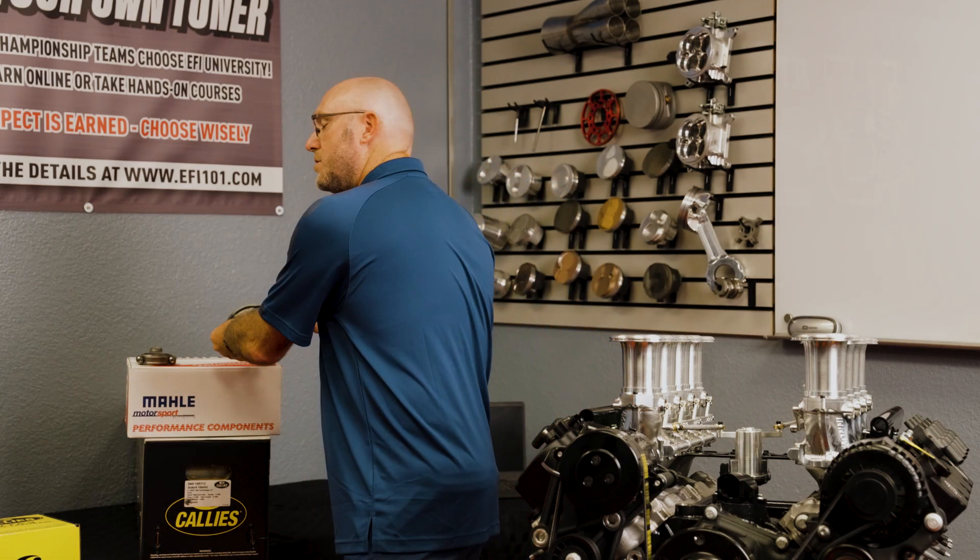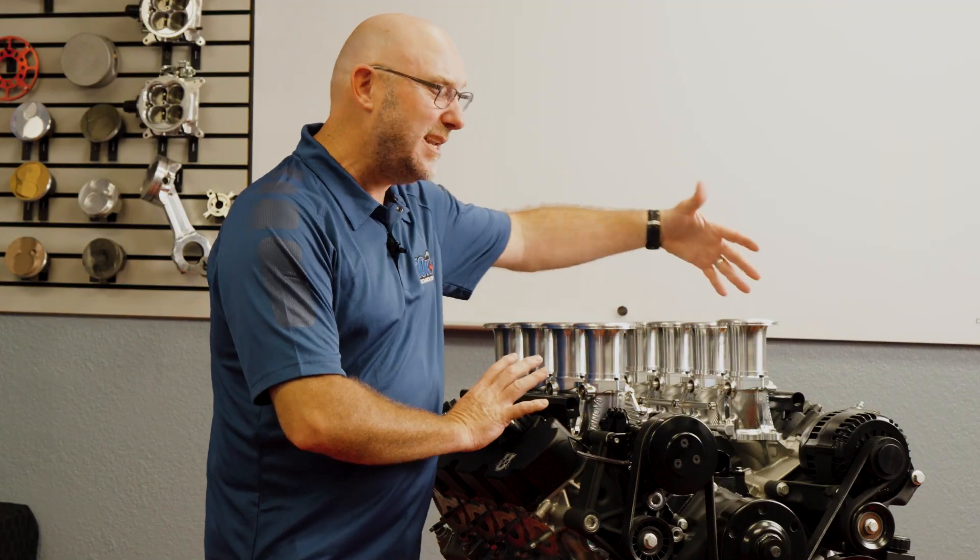This package uses a four and a half inch stroke and a 6300 rod. It'll get you 511 cubic inches in basically a small block package. This is our top of the line model, and this is what's exciting — on pump gas, 91 octane premium pump gas, this package right here will make 750 horsepower and right about 750 foot pounds of torque.